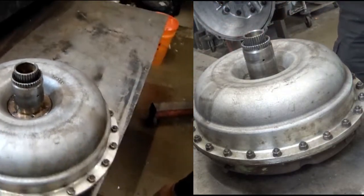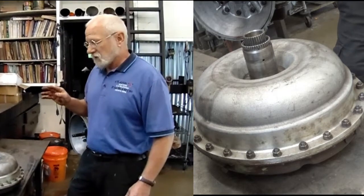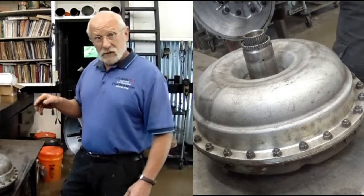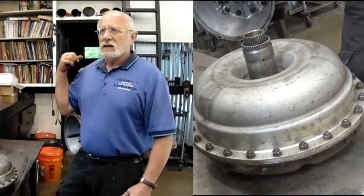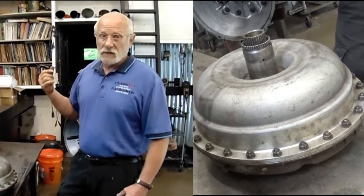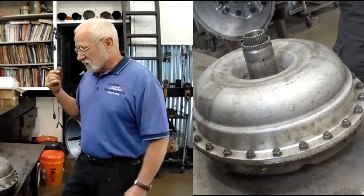I can also see that in the past, not only has this been hot, but it has leaked around where the stub shaft mounts to the housing and has thrown oil out in the past, although right now it's not doing that. The owner's complaint with this car is that it was not such a bad shifting transmission, but it had the usual complaint of groaning into direct drive. Also, rather unusual with this transmission, changing the throttle linkage had very little effect on how the transmission shifted. So that tells me something is wrong — we have to discover what that is.